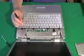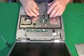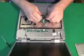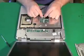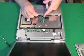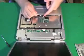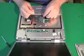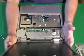Now we have access to the keyboard and we'll take the four screws off that are holding it on. Keyboards sometimes have screws like this one, and they're always attached by a wide ribbon cable that you can just grab by both ends at the connector and pull out. Now I'm disconnecting any ribbon cable I see — this one is for the touchpad — because when I take the top plate off, that ribbon cable will still be connected unless I remove it now.